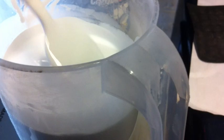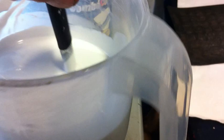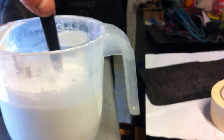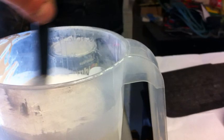You want the white spirits and the paint completely mixed together. You need to drag the spoon round the bottom to make sure it's all mixed in. You end up with 575 mils of paint. When I come to do the bigger panels I'll be mixing a litre at a time. Just mix it, pour what you need into your tray, and then put something on top of the jug to stop any bits getting in and to keep the paint from going off.